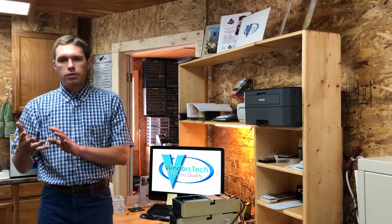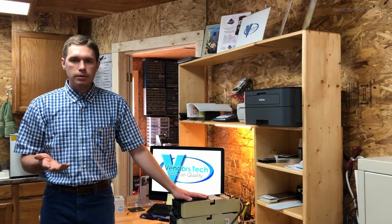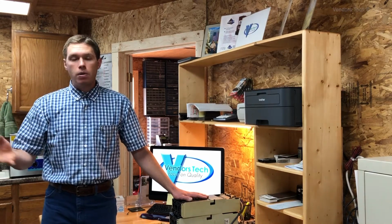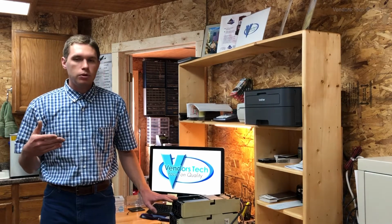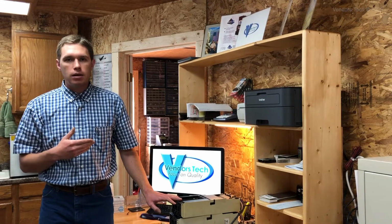CoinCo 9300 series are about the same price as these are rebuilt, so that's a fantastic alternative. Doesn't cost any extra. If you're buying anywhere else, be sure to ask for a CoinCo option instead of the TRCs from now on, and try and phase out your TRCs, because in the long run they're going to be working better, because we can actually put new parts on the CoinCos, whereas we can't on these anymore, and they're going to be lasting a lot longer.